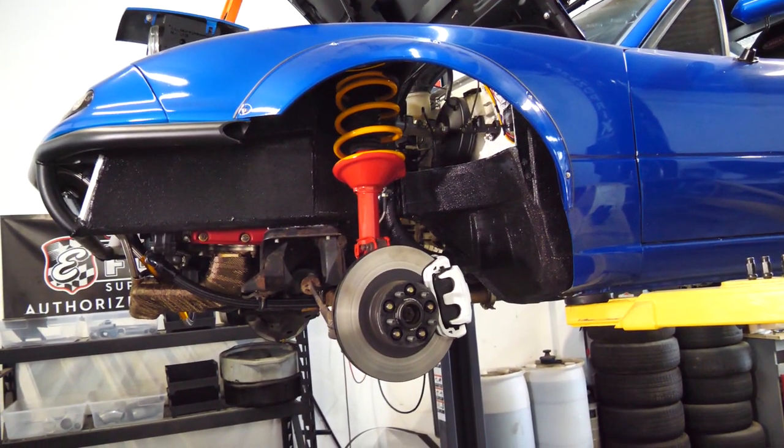For rallycross and off-roading in general, you want a shock and strut setup that compresses a little bit and squats when just sitting on the ground. That way if you go over a deep bump, the wheel will be pushed down and all the tires will always stay on the ground. If it doesn't compress at all, then going over a big bump the wheel won't go down and you lose traction. So let's hope that when we put this on the ground it compresses a little bit. I'm gonna quickly paint the lower control arm a bit prettier and then head over to the lighting stuff.